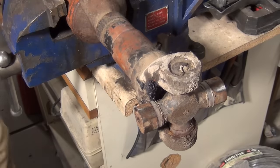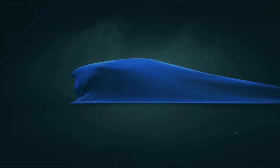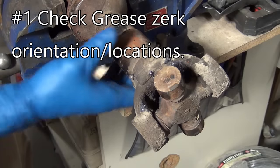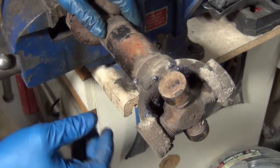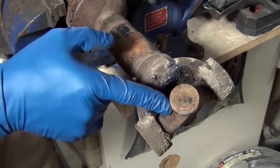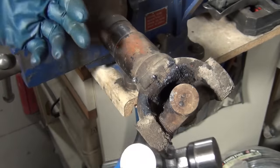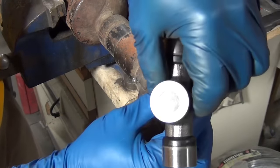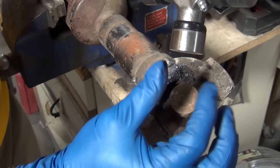You can see that movement - tada, new U-joint, so solid. One of the things I like to notice immediately is that you've got the grease zerk on this. For the shaft to slide in and out - you see how that moves - you can have the length change without breaking anything. There's a little bit of a bulge here; that bulge accommodates a grease zerk. The new one also has a grease zerk. Line these up, look at how they are across from each other, make sure they're the same length. Take the caps, make sure they feel the same when you squeeze at the joint.